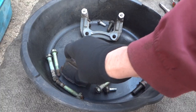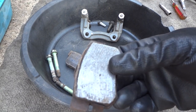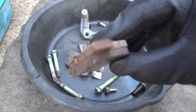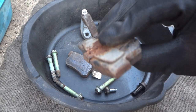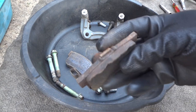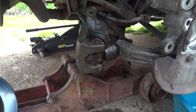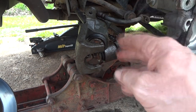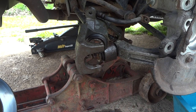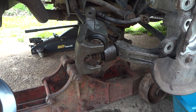Before going further, I cleaned up and made sure these calipers were working. Someone had replaced one of the calipers but didn't replace the brake pad - just reused the old pad with the new caliper. The pistons in these brake calipers are now working, so we'll reuse this pad for now. I also want to add a disclaimer - do not try to compress these pistons straight in, these are not compressible ones. You actually spin and turn them all the way back in. That was my mistake - sometimes I make mistakes and I'll publish them on video to show we all make mistakes.